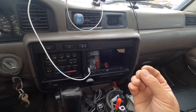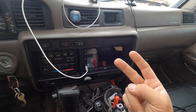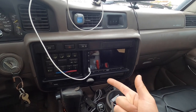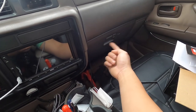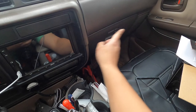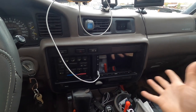The next issue I had was that my speakers were all buzzing - there was white noise and humming. I did some research and found out that you have to bypass the factory amp. Some people rewire it, but you can do a simple bypass: just get behind the glove box and unplug it. There are two screws that hold the glove box open, and you can see the amplifier right there next to the ECU. There are two plugs you just have to unplug. I unplugged that today and now there's no humming, no noise, nothing.